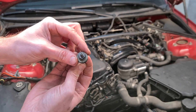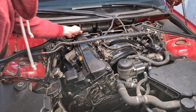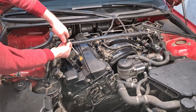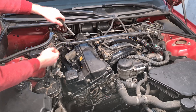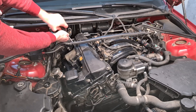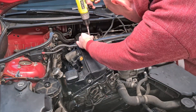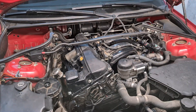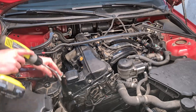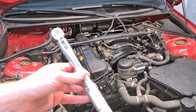There is one exception: this is the bolt that goes to the back and holds the bracket for the vacuum line. Start at the top center bolts, just make them hand tight. Go from center towards the edges of the valve cover. This way the valve cover fits nicely and is not under any weird stress. Now we torque the bolts to 10 newton meters.